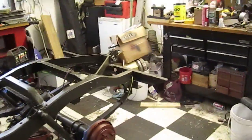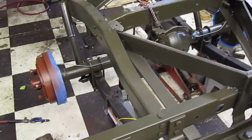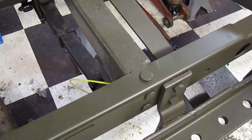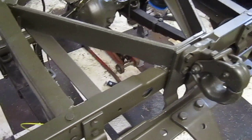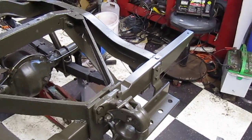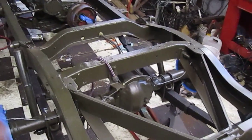The back bumper was rusted completely out, and of course these original Jeep bumpers are riveted on from the factory and welded. So I bought a new bumper, but I actually had to make a rivet tool that would make the heads on those rivets right there. I did that with an air chisel, heated the rivets with a torch, held them from the back with a piece of inch bar, solid steel bar, and clamps, and was able to duplicate as close as I could what the original rivets in the bumper would have been like.